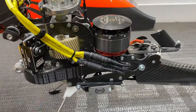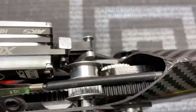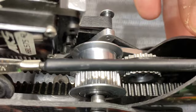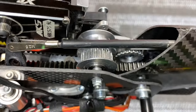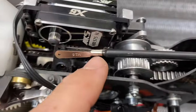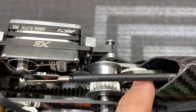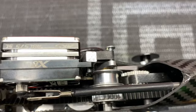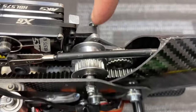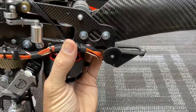I'll flip it over and show you. We have two different pulleys — actually three — and then your tensioner pulley right here. The top of your belt rides along here, goes across the main pulley, then runs down, goes under this pulley and around this pulley. To get the belt on you just remove this tensioner band, the pulley drops down, and then the belt can go on. Once you get all that it's free and clear.